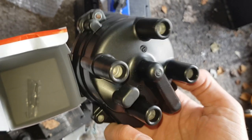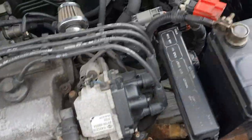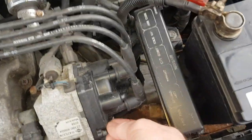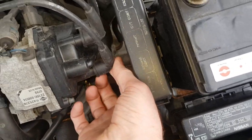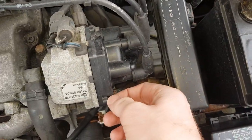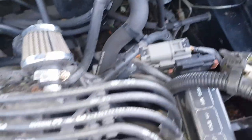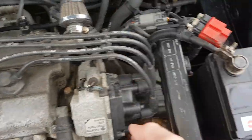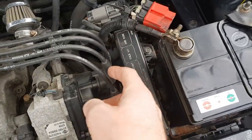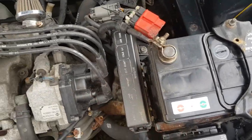Some of them don't have that marked, so just bear in mind which wires come off when you take them apart. This is it on the car — right-hand side of the engine. I think these are six or seven mil headed bolts, but yours might be different. There's one there, one there, and one right underneath as well. Sometimes it's better to just take the cap off with the HT leads still attached and rest it to one side, then take each wire off individually and put it back one at a time.